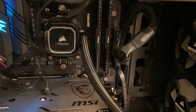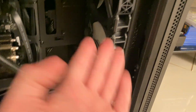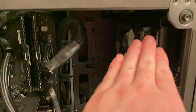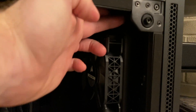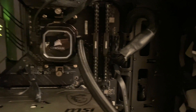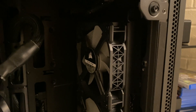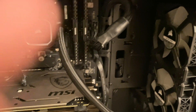My computer has made a funny noise recently, so it's why I've changed it. Essentially, what I've done is I have managed to secure this in a different position higher up — not as high as it could go, but high enough just so that the top level of the radiator, which is like there if you can see my finger, it's higher than the pump. So any air that accumulates in this radiator as the water evaporates will be higher than the pump and won't trap in the pump and break it.